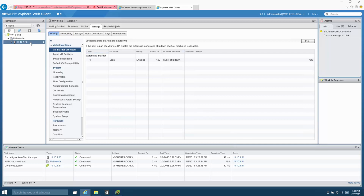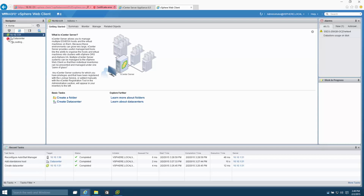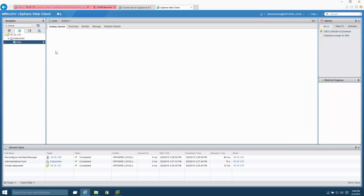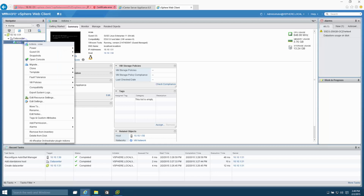All right. So here's our ESXi host, and it's running all of this workload. If we look under the list of VMs, you'll see this one appliance called VCSA. Its amount of memory that it uses is going to be far less than the 8 gig by default we've given it. Right now it's using 3.7, so I could probably move that down to 4 gig without incident. That's been true in previous releases. This one looks a little more heavy with all that stuff they've added.